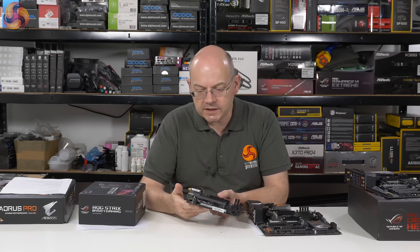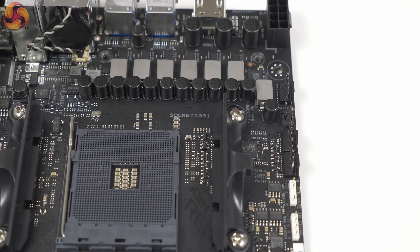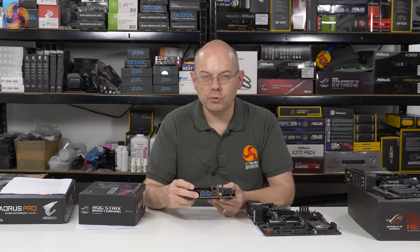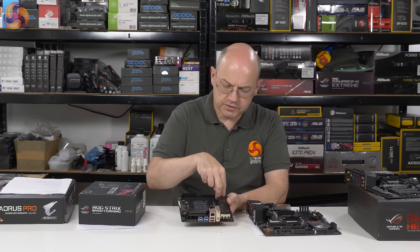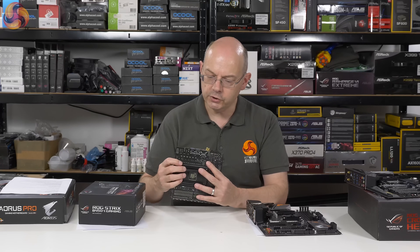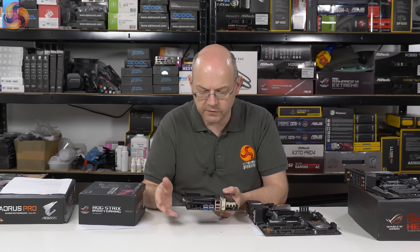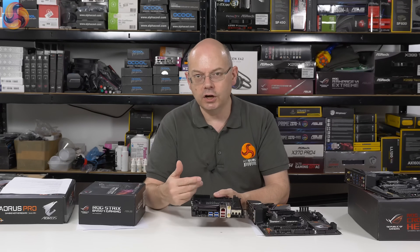On the other hand, this lovely little Mini-ITX board has a whole load of USB on the outputs. It's got an HDMI — a curious thing because the previous B350 model did not have HDMI and did not have a graphics output. They don't really want you putting an APU in this board: the reason is it's a 6 plus 1 power design, with only one phase to support the SoC and graphics, which isn't really a great idea. So you do have HDMI there, but you can probably forget about using it in anger. It's Mini-ITX, so you've got two SATA, two in-board SATA, two memory slots, and a variety of headers and connectors. You don't get a USB 3.1 Gen 2 header on board, and no Type-C on the IO, which is a bit of a disappointment. You do get the same little riser-type affair for the audio that you got on the B350 version.